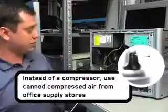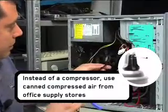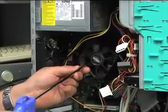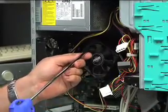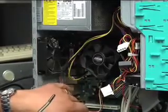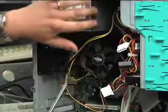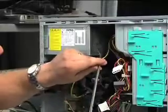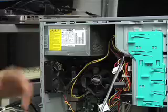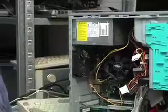With the air compressor nozzle, just try to control it with both hands because you want to keep the fan blade from spinning. You can be a little more precise that way. Just go through and try to clear the dust off the fins on the heat sink on the inside there. You'd also want to be careful not to dislodge any wires or touch any electronics — you might actually cause damage that way. With the power supply, it has its own little vent holes, so try to give quick, short bursts to keep the fan blade from spinning too quickly, which could also cause damage. And just keep going until you don't get any more dust coming out.